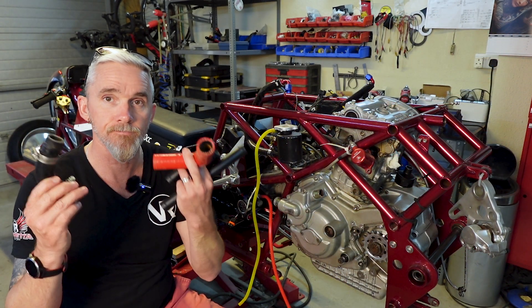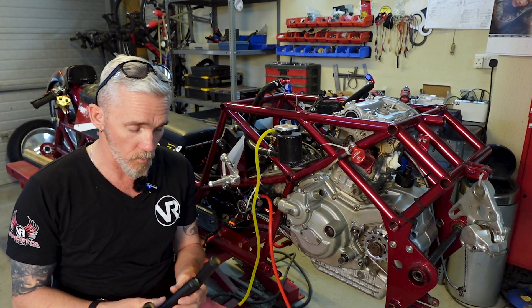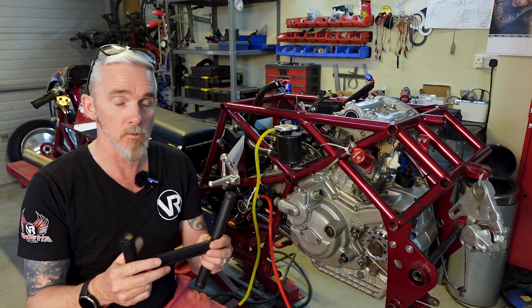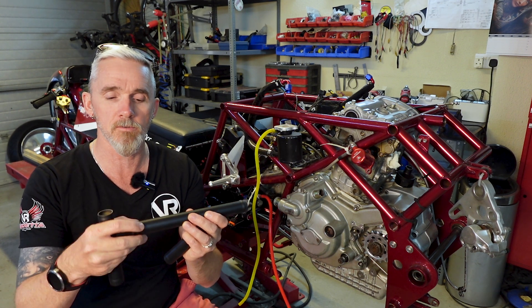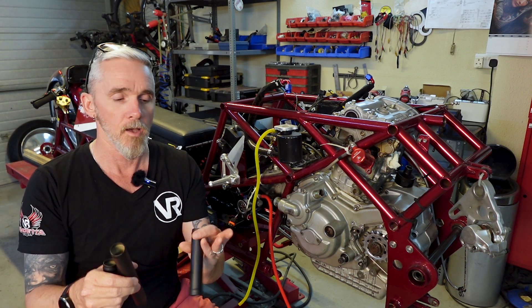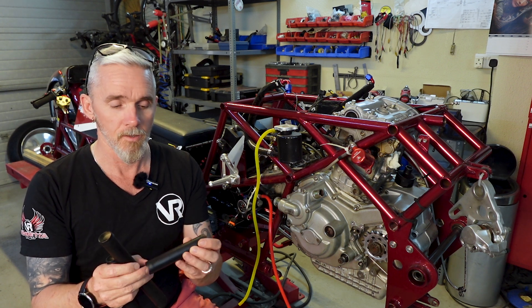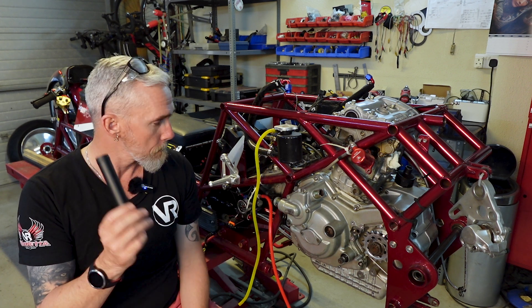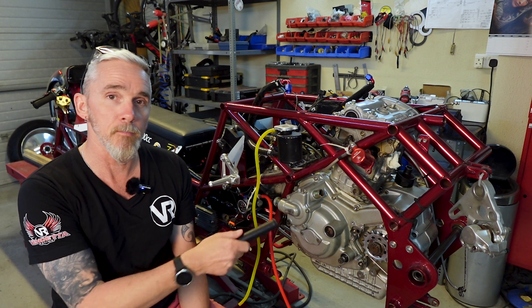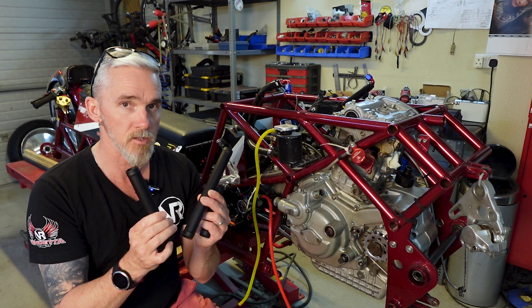Next on the agenda: coolant hoses. One modification we did for last year was to powder coat all the aluminium coolant hoses. These were made specifically for the bike — just thin aluminium tubes with a flaring tool, so you can make many sizes. And even the flaring tool is really cheap. But what we found, like everything else with bare aluminium, is that salt starts eating it. So they were thrown in the powder coating pile at the same time. We fit these first so we can build everything else around the coolant hoses, because trying to get the coolant hoses in when you've got fuel lines and wiring in place gets a bit challenging.